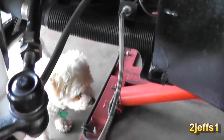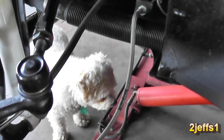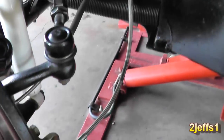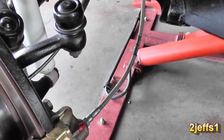Last but not least — stainless steel brake lines. When you have a brake line that's this long and that small, when you step on the pedal it's going to feel squishy if they're just regular rubber hose. The stainless steel brake lines? Guaranteed, you will feel a difference in your pedal.